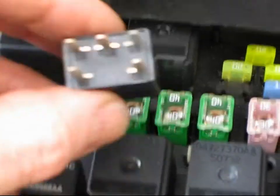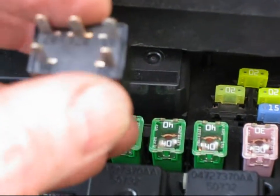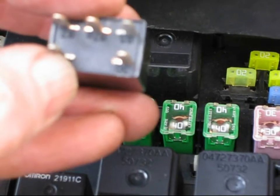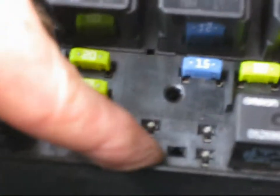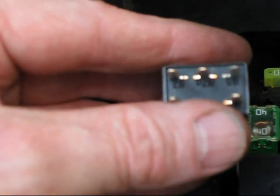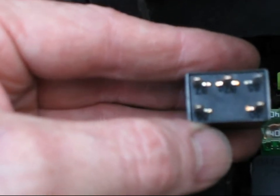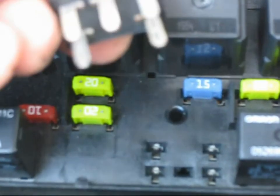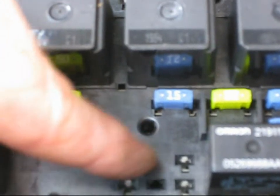Pins 85 and 86 are the pins that will activate the solenoid. In the resting position, pin 30 will be on 87A, so power is being delivered from here to here. When the solenoid is activated, that middle pin 87A is actually just an empty hole — it doesn't do anything in the resting position. But when the computer activates the solenoid when you turn your key, it switches over from 30 to 87, diagonally, and that turns your fuel pump on. Those are the two pins we're going to short. Remember, when you're looking at it from outside the socket, it's reversed — so pin 30 is the upper right-hand hole and 87 is the lower left-hand side. That's where we're going to jump across.